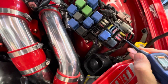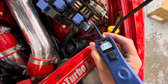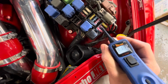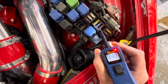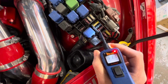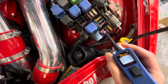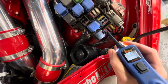This is our engine control fuse right here. With the power probe, you'll notice it shows 11 volts — not horrible, same with the AC fuse. But if you check the other fuses they're a little higher and actually trigger the power probe to show good power. This one doesn't — it's about half a volt difference.